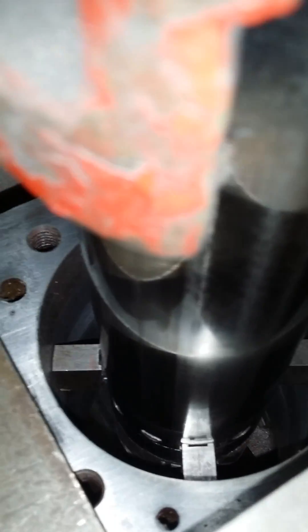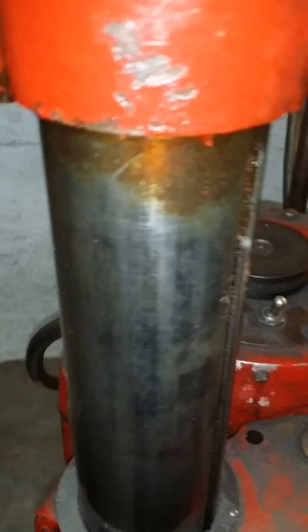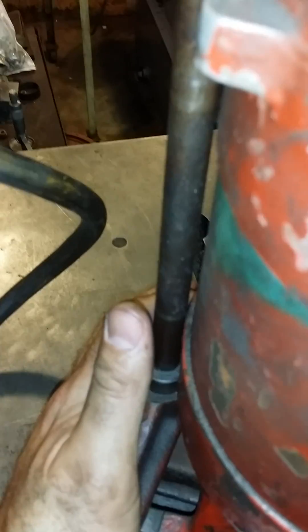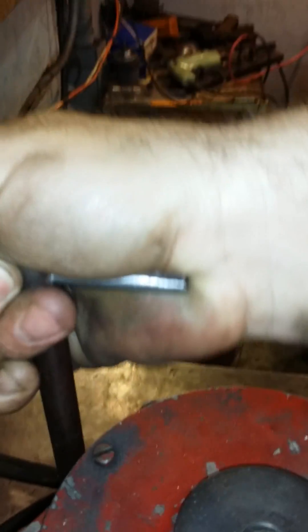Go back down and look — the cat's paws are now all touching the cylinder walls, so the boring bar is now centered in the cylinder bore. Come back to the back of the machine. I usually place one hand down here on the bottom to hold the clamp, then reach around the machine with the other hand and tighten it up. You want it good and tight — that locks the bar to the stand so it can't move during the boring operation.